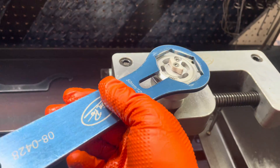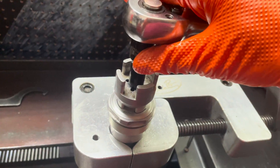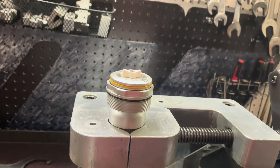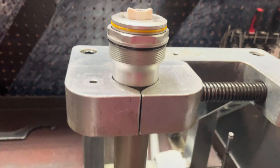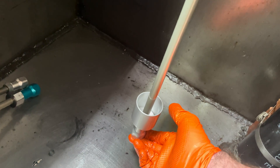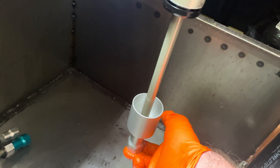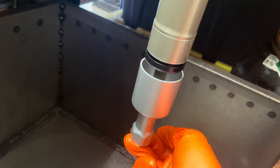I'm going to use the fork cap tool with one hand and the compression removal tool with the other in order to safely remove it. We have unthreaded our cap and we can see the o-ring has popped up. The easiest way to get that out is to push up on our cartridge rod at the bottom. Do it slow because you can feel some pressure — if you do it fast you're going to shoot that cup out the top and get oil everywhere. So go all the way up until it stops.